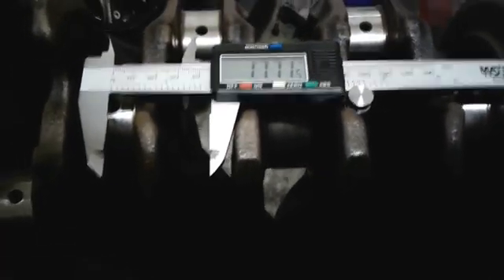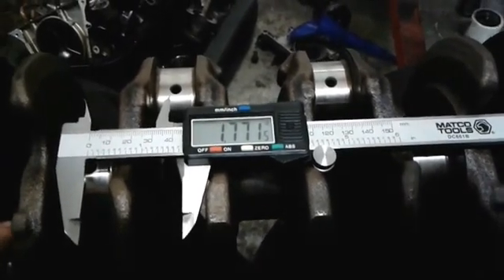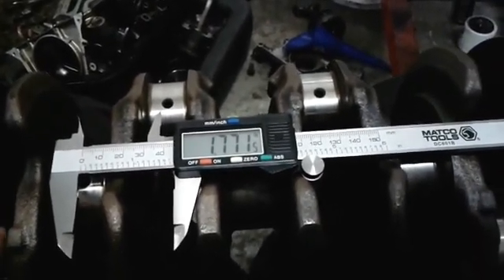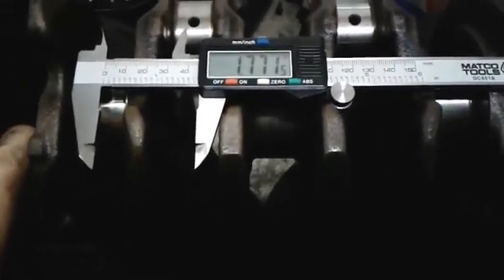Personally, I don't like to grind cranks — not so much because I'm scared of them not working, because I have used ground cranks before with no problems. It's just that here in the area and down in South Florida, it's relatively easy to get most of the cranks I'm looking for. And you can get a healthy crank at the same price it's going to cost to grind one down. So I wouldn't recommend anybody buy a crank that needs to be cut. If you get a crank that's healthy and turns out to be cut, then that's no big deal — I wouldn't pay a premium on it, but you can still use it if you need to in a pinch.